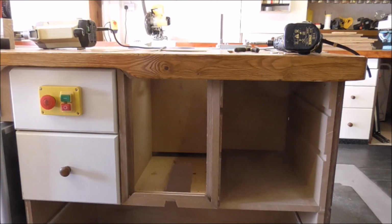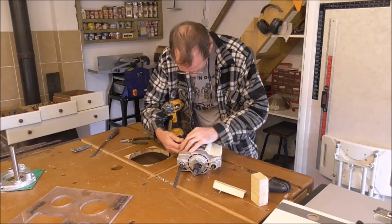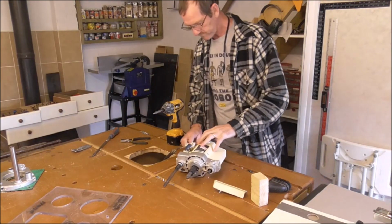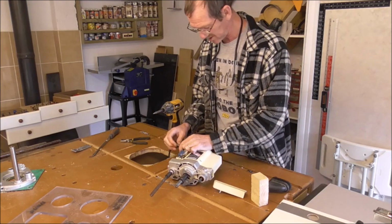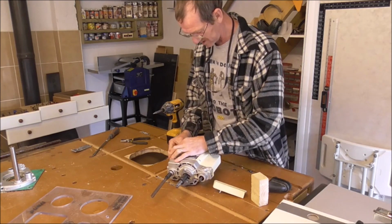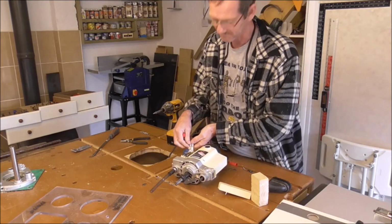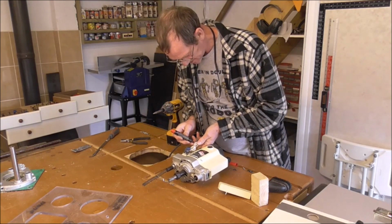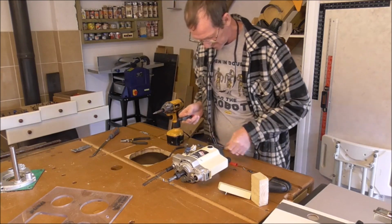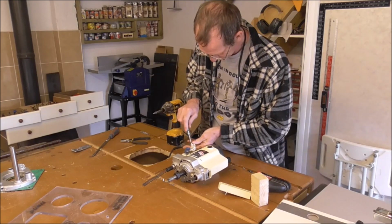First I need to find out if that router is salvageable or whether I need to replace it. And typically with these things in the UK, the appliances are colour coded, as far as the first strip connector. So before we remove it, because everything there is one colour, let's just mark where we want the live to go back in before we disconnect it.